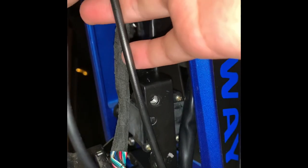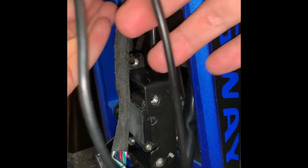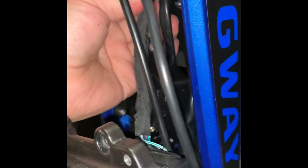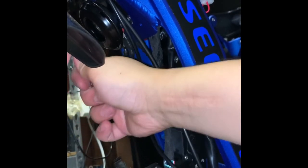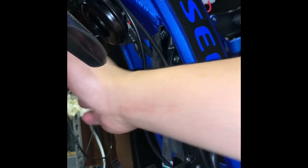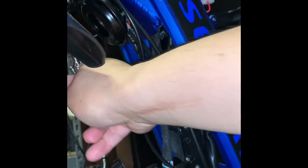This bike is all there to be a pain. You may have to actually move the horn. I'm going to loosen the horn slightly by loosening these bolts up here — I'm not going to remove it completely, just loosen it. Once that's done, we can move these connectors around. That's really most of the work as far as removing the stock controller goes.